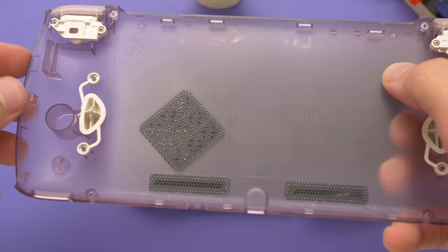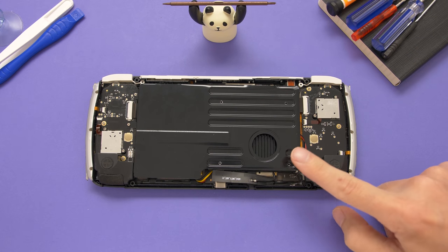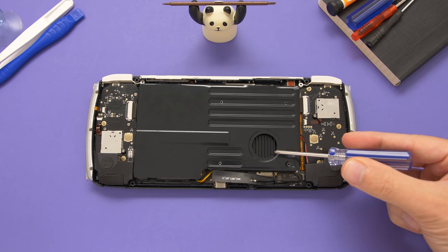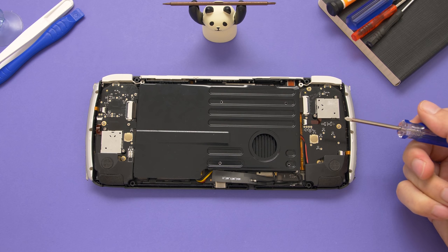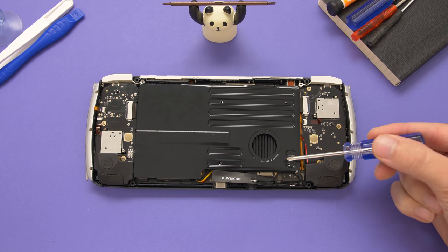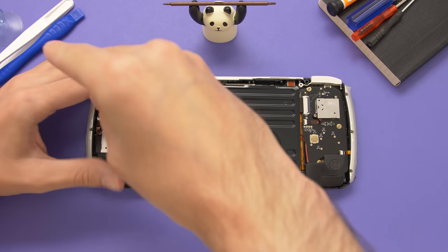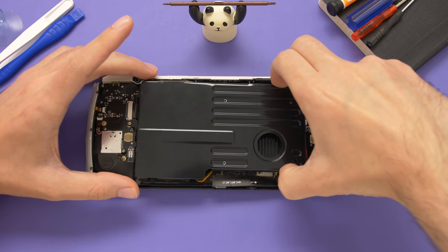This is the back shell of the prototype atomic purple. The next thing that we have is this metal shell, and this is from the Odin Pro. As you can see, it has a fan hole there, but this doesn't have a fan right now. I don't know if the Odin Lite will have a fan — it probably should, but this prototype is kind of slapping together a couple of different things. Normally we would have screws here, as we'll see on the Odin Pro, but this one just has two screws on the side, so we're going to loosen those screws and lift off this shell.